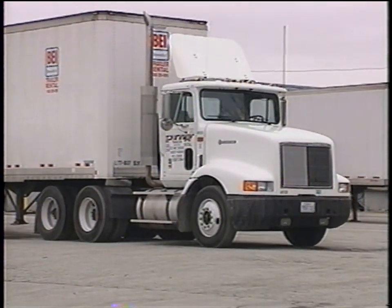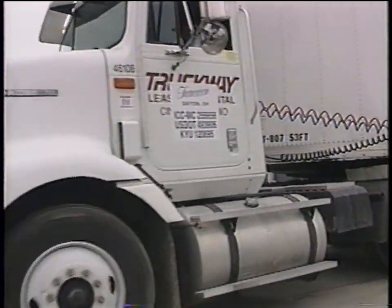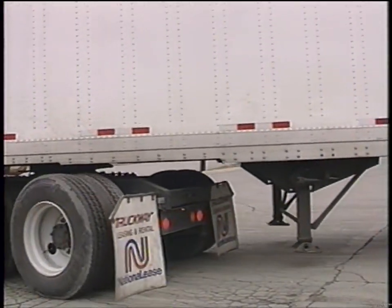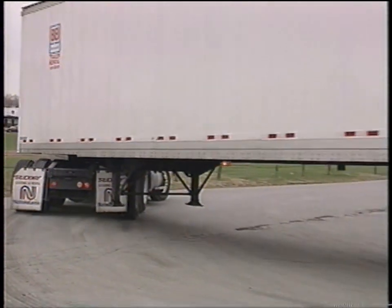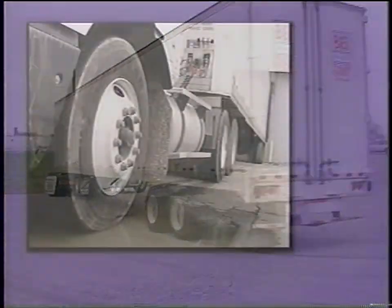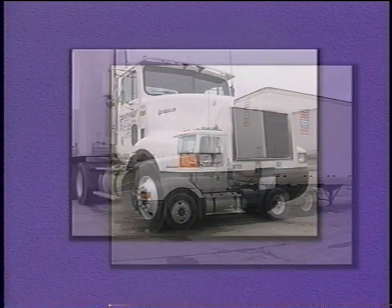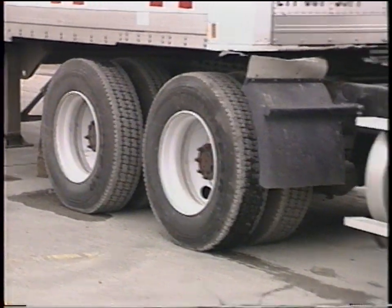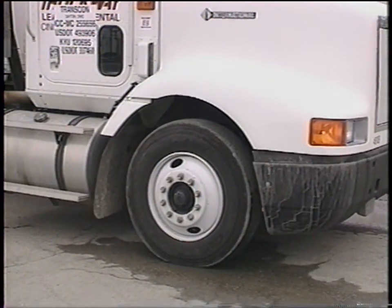Virtually all the energy used to make these large vehicles come to a quick stop is absorbed into the brake drums as heat. The ability of the brake drums to stop a vehicle has become even more important in the last few years. Trucks are becoming more friction-free by utilizing radial tires, streamlined body shapes, and less powertrain friction. This reduced friction increases fuel mileage. However, the brakes must now do more work to decrease vehicle speed.